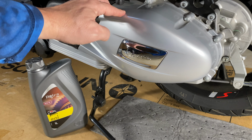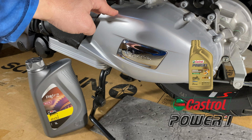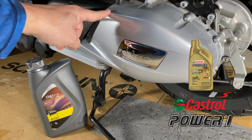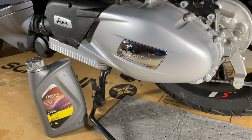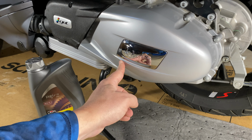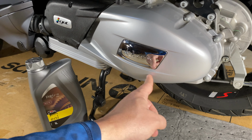But also the motor oil, as good as I like the Castrol synthetic motor oil, that Power One RS, good stuff, the official oil for this scooter, this engine, I think I'll probably change that at 3,000 too. Even Robot from Vespa Motorsport admits that he usually changes his about every 2,000 to 3,000 miles rather than waiting for that 6,000 point. Well, I don't know about the 2,000, but I have heard him definitely mention 3,000. I think 2,000 if he said you ride it hard.